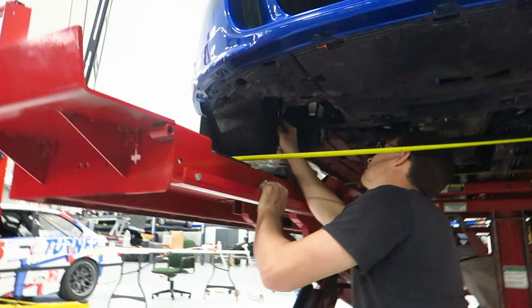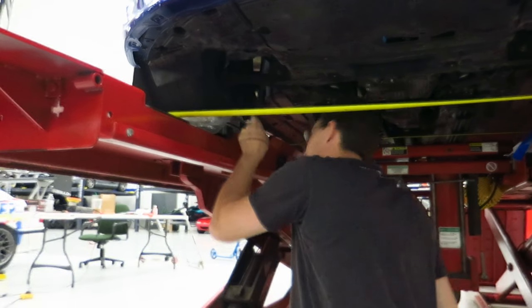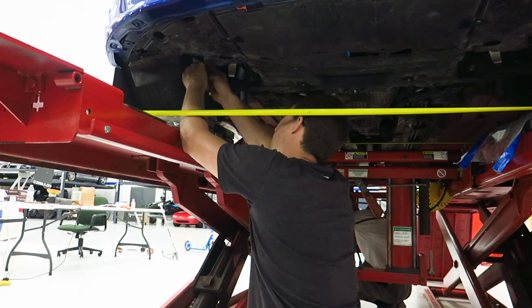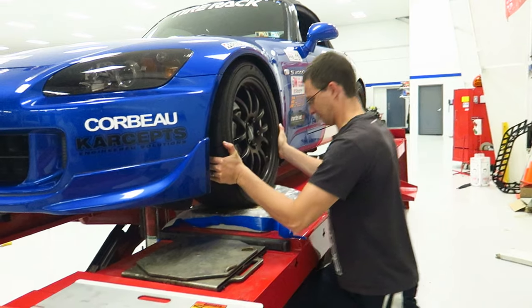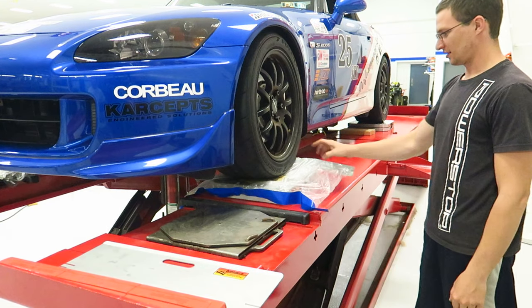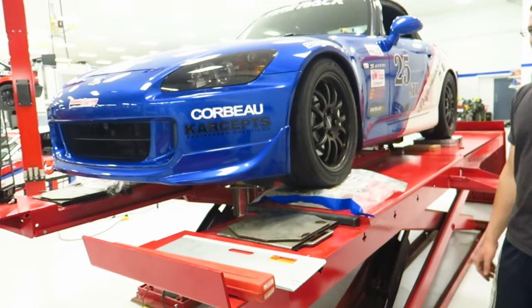How much will gear fluid change how the rear works? It completely changes how the rear works. I'm running 75W-140 Amsoil. What's the slip package in it? I don't know — six slip plates. For the alignment we're using slip plates — just a trash bag with a little bit of grease between layers. The perfect slip plate — no flex, no displacement, and reusable. We use these to do our sweep for caster.